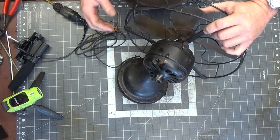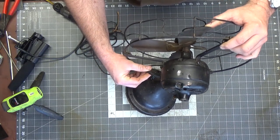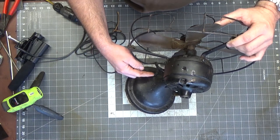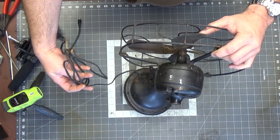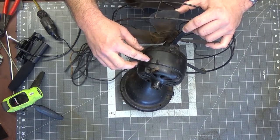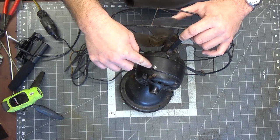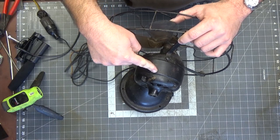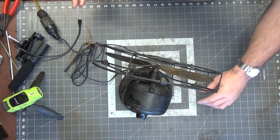The issues I'm seeing now are that the cord — this has got three speeds so there's four wires — is starting to delaminate and coming apart, so I'll need to rewire that. It's missing the grommet, the original cord has been knotted, and it appears to have been repainted at some point. It's flat black now, but from my research this motor should have been a very dark green.